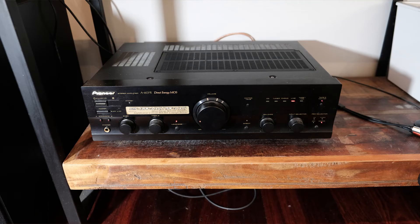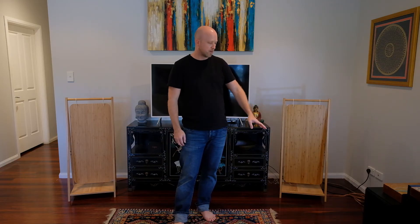If you have any questions feel free to comment below and I'll answer them. Before playing some samples, I'll run through my setup quickly. I'm playing music from Spotify on my phone, which goes to a Google Chromecast Audio straight into the line-in of my integrated amp. From there the signal is split through a miniDSP — not the HD version, just the regular one — where I apply a bit of broad EQ to even out the frequency response slightly. It's a small improvement but it's in the chain. From there sound goes to the panels running full range, and also to the Canton 10-inch active subwoofer, which is dialed in to fill out the bass where the panels are lacking.